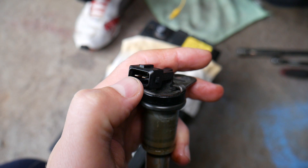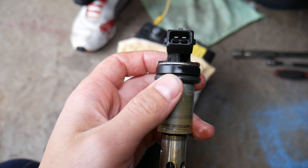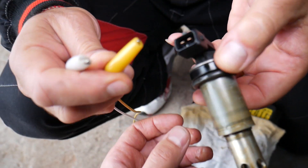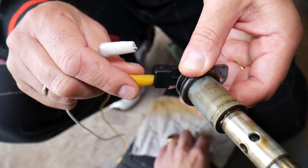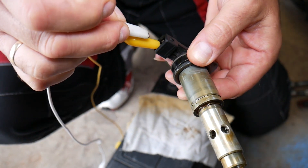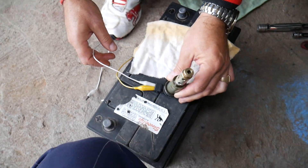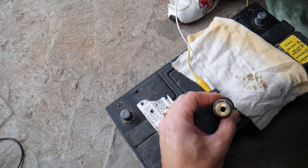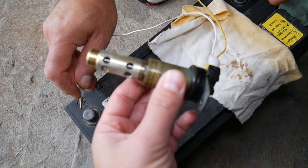It's super important when testing these wires not to let the connectors touch each other, or you will burn your VANOS solenoid and need to replace it. We recommend using alligator clips — we'll put the link in the description below. Go ahead and install them — it doesn't matter which way is positive or negative. Those are connected now, and we're going to go ahead and apply 12-volt supply and listen to what happens.